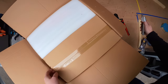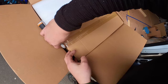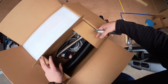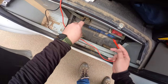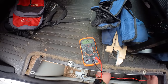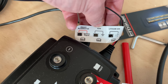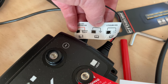While we're working on the van, there's just been a delivery — that'll be the diesel heater, looking forward to putting that in. After letting it run five or ten minutes, we're still at 14.9 volts, so this has just got a regular alternator. Because I've got an AGM battery and no smart alternator, I only need to wire up the ground.